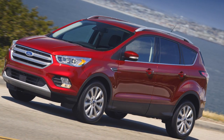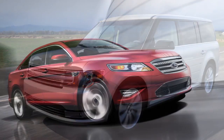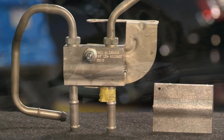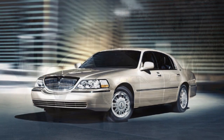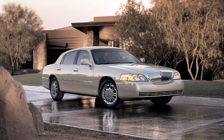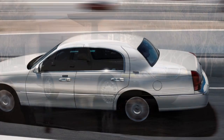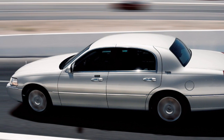On the front-wheel drive six-speed transmissions — 6F35, 6F50, and 6F55 — replacing the bypass valve is mandatory. On the Crown Victoria, Grand Marquis, and Town Car, you'll find a 4R75 combination transmission cooler and air conditioning condenser. Here the bypass valve is located inside the cooler and the unit must be replaced.